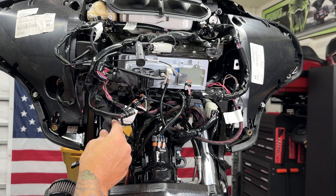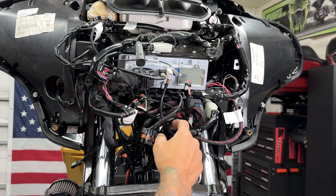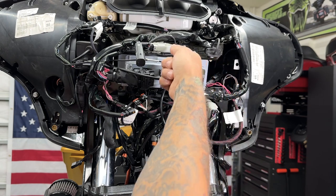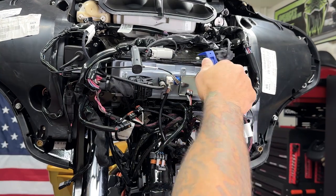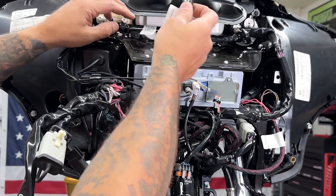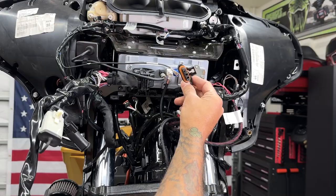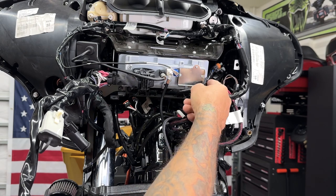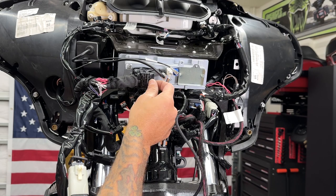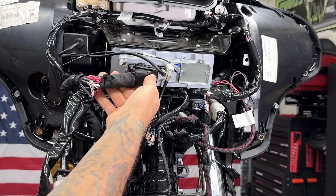As you can see, this cable runs up from the right side, so anything that I disconnect here is going to stay to the right. And then you have your left cables here, they're going to stay to the left. A lot of these are held on by Christmas tree retention clips. So just pop these out, follow them down, and then disconnect them. This is just a headlight connector — this will stay attached to the fairing. So I'll disconnect the radio connector. You have this tab located right here. Just push down on that, and then you just swing this lock open and pull it out.